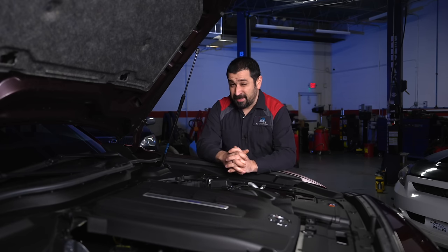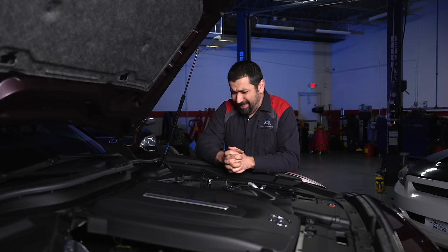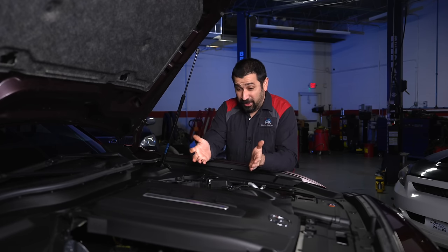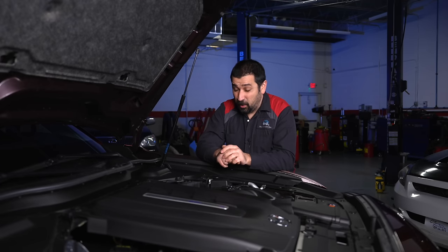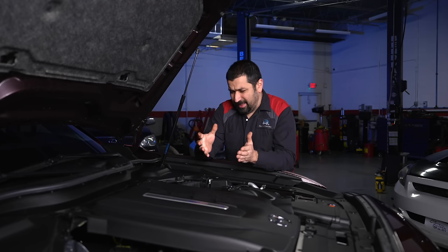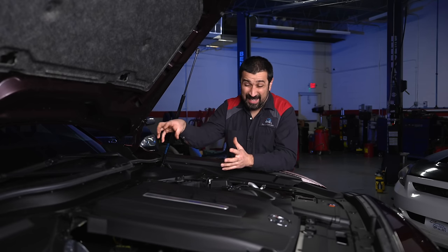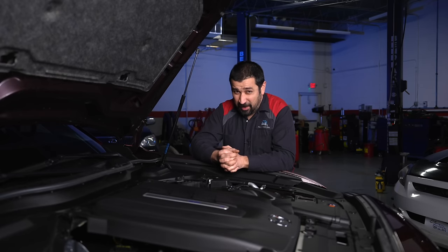This engine is designated PYUL, and it's actually quite old school. It is direct-injected only, which means carbon buildup is a possibility, but they don't have the injectors on top of the valve cover like many manufacturers are moving toward. They have them right underneath the intake manifold — a much better place that makes service very simple. The high-pressure fuel pump sits on the side of the valve cover, not on top. It's driven by the camshaft; things are very basic.